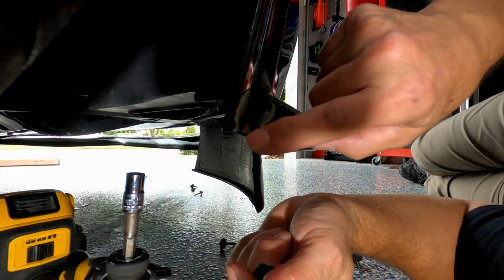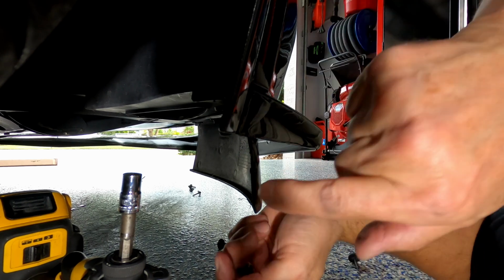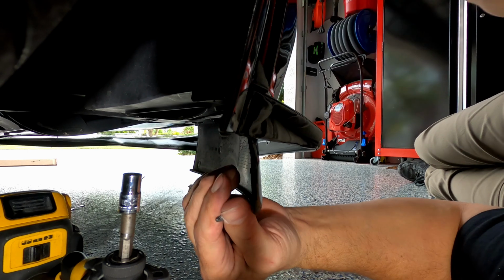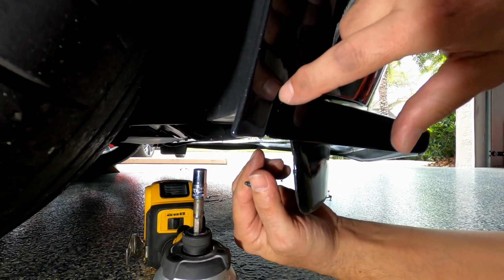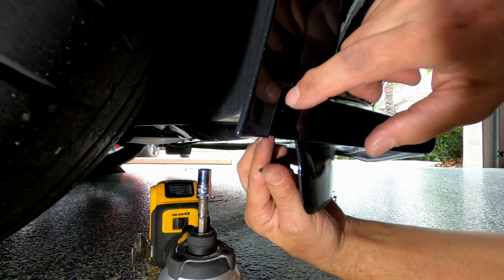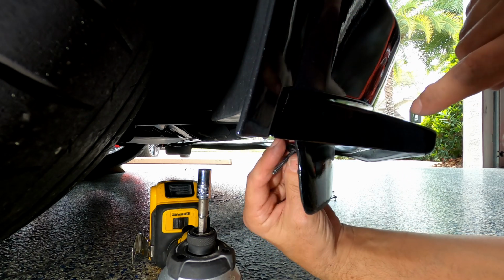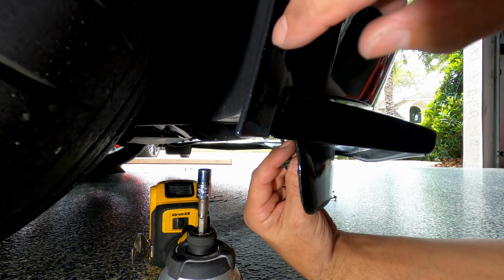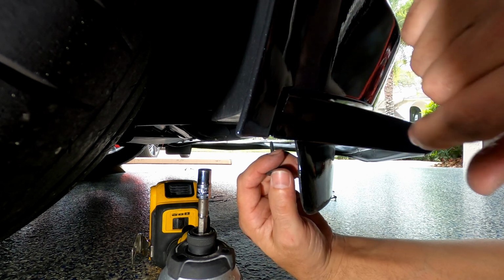All right, so what I suggest is kind of putting some screws in the center without doing the double-sided tape yet, aligning these edges here so they can be nice and tight. If not, I ended up getting them with a little space right here. So I'm going to do these first, and then I'll go ahead and glue it, and then I'll work myself towards the center. I already did the other side, so just make sure these line up okay.